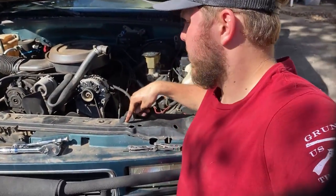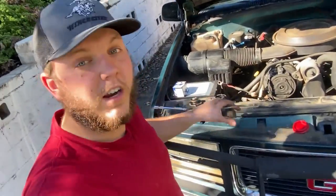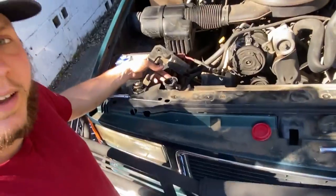At these bolts here - 10 millimeter - we got one here on the opposing side right by the fill cup. I'm gonna take those out; those are securing the top of the radiator down. Once you get those bolts taken out, this piece comes off - that's all it is. Now your radiator can come out. We still had the overflow hose to take out, which just had a Phillips head on top of it. Take that off - it slides off nice and easy. Now we need to do the trans cooler lines.